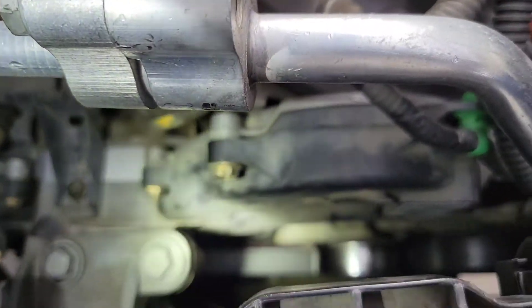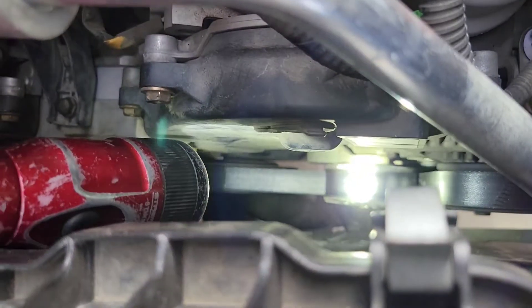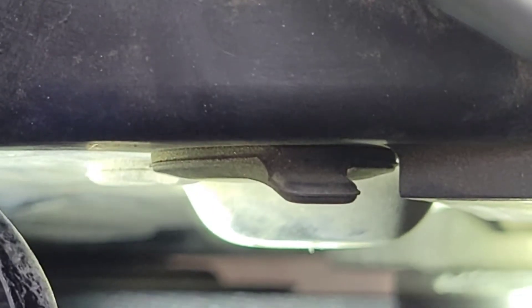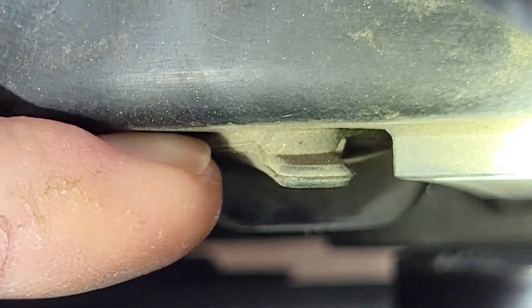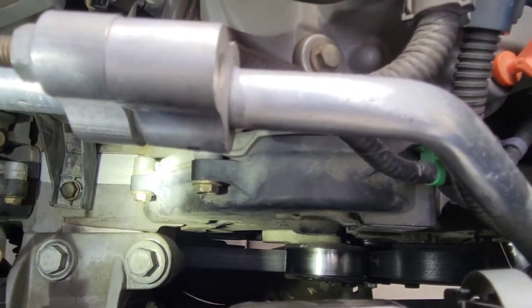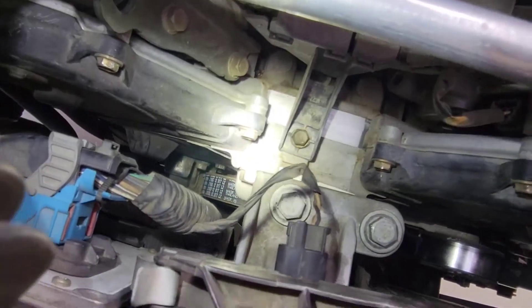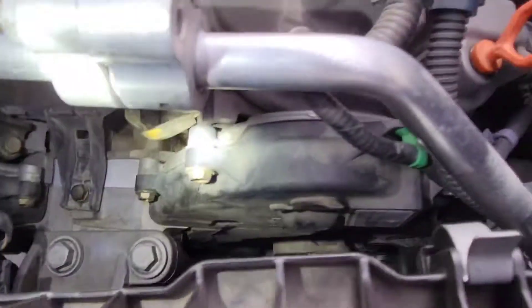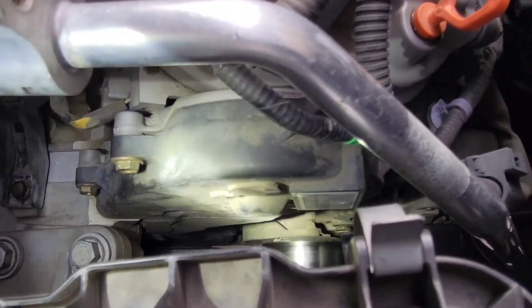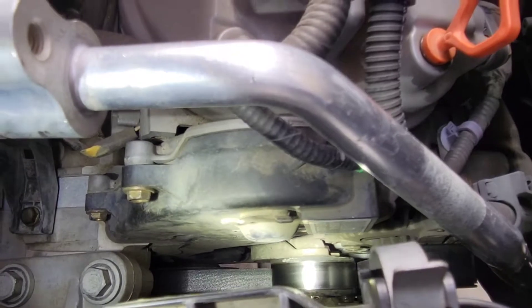Once you've gained access, you're going to take off this front cover. Right there is a rubber plug — you can pop this plug out. You rotate it down and you turn the engine over until there's a one on the cam sprocket and it will line up in the window. Then there's a mark down on the balancer that will line up. Once you see the one in this window, it's not mandatory that you set it to top dead center before you take it apart — you can use the marks inside the engine — but this gets you close.